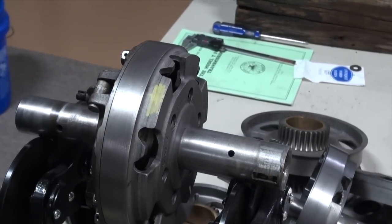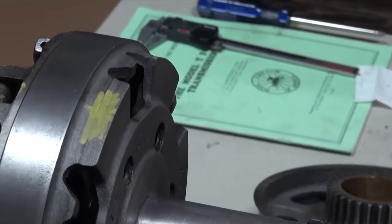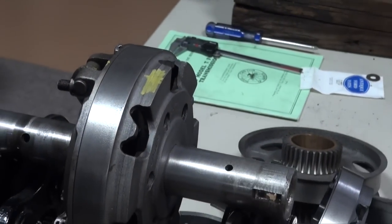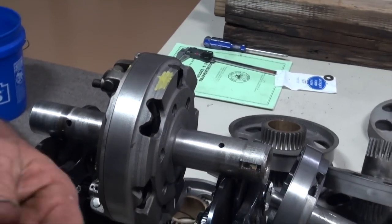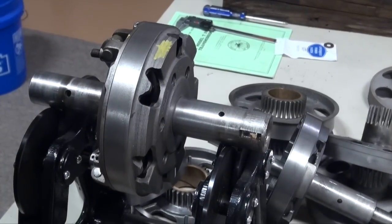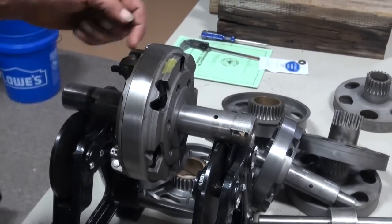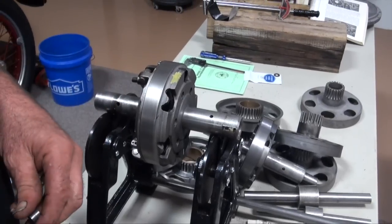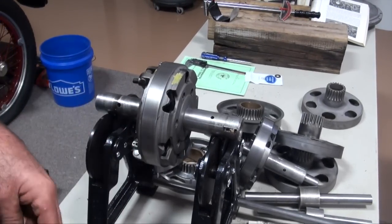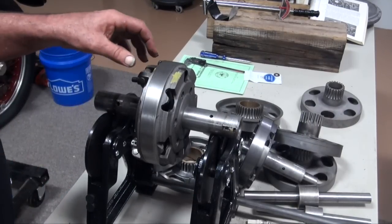Some people are concerned with that, but we've only been doing some of this sort of stuff for 20 years or so. In fact, I've even had transmissions come into the shop where some individual did it before — this is nothing we invented. I've come in and found drums where there was a three-eighths inch bolt and a nut in them, and the drum didn't crack. It was happy and it was in balance. So I don't see there's any problem adding or drilling holes as long as you're careful about placement.